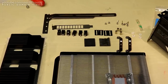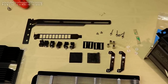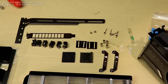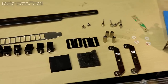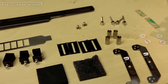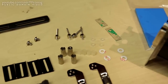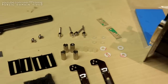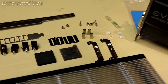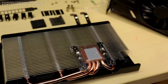The S3 also comes with a ridiculous amount of mounting hardware — we won't need all of that. Starting at the top left, we have a graphics card bracket, a bunch of little C-clamps which hold the aluminium plate in place, two foam pads, four metal holdy things which are supposed to hold the graphics card's back plate in place, clamping around the back of the bolts which mount the heatsink, some spacers, and even more bolty things, and a bunch of washers. You only use one set of these depending on which GPU you have, as well as what seems to be an alternative set of mounts required for some GPUs. There are a total of three different holes on that one and there's one mounted already to the cooler, so you get six different hold positions — which is a nice touch.